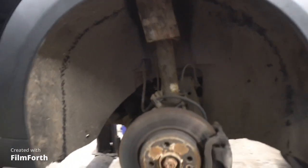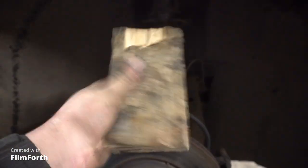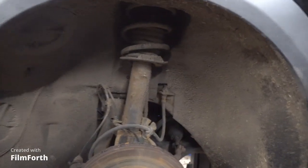The Mini is on the ramp — we got her out from the yard. I'll just remove the special mechanical help, the old block of wood. I cut the spring out; this is what it should look like — there's the spring all located in. But due to the potholes and the state of the roads, it ended up snapping. It came down off the spring pan into the tyre, ruined the tyre, and you can see where she was smoking when all the bits of rubber got caught on the inside of the wheel arch.